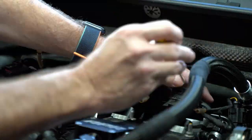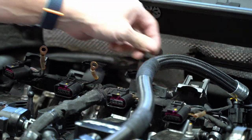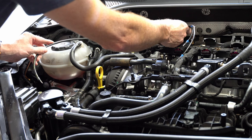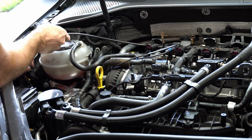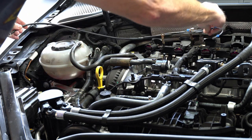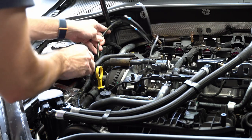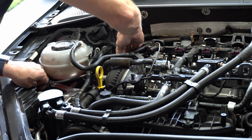Be careful — you can break these little plastic covers, but it's not detrimental if you do. I'm just going to lay out where I think I want to run this ground wire to the passenger side. The grounding lug we're going to use is behind the passenger headlight right by the motor mount. I want to make sure I understand where it's going before I start installing the wires into the plugs. I think I'm going to run it right through here — that's the route I'm going to take.